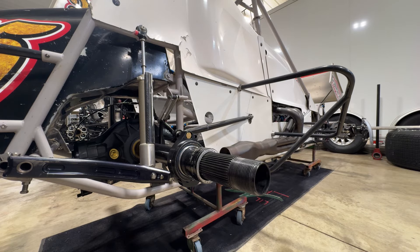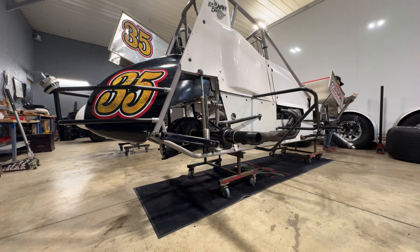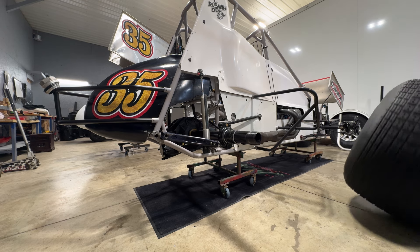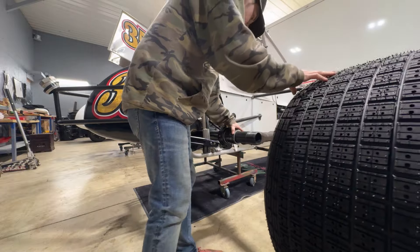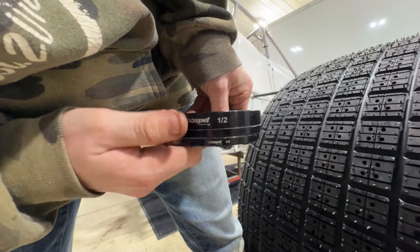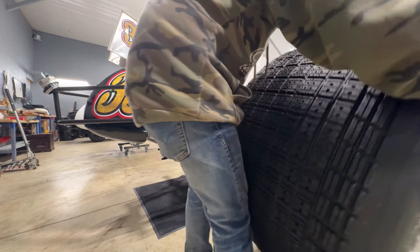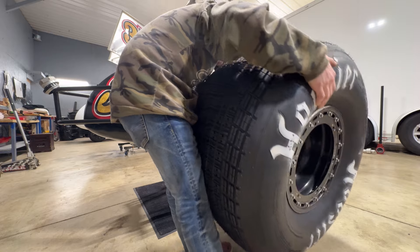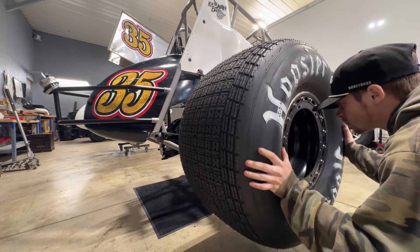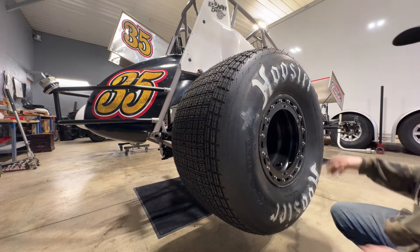MPD makes that kit and it's so much easier. There are old school guys still on the cones and whatever, but this is so much simpler. All your spacers are labeled — MPD half, MPD quarter. A lot of old school guys have old washers or spacers with no writing on them, so you're either guessing, you know by looking, or you have to get a tape measure out.